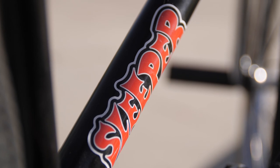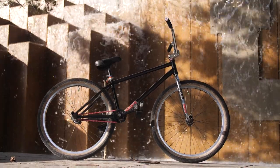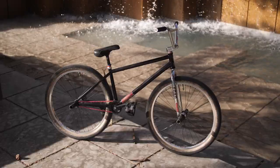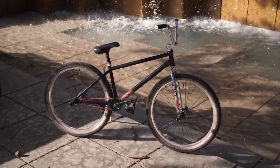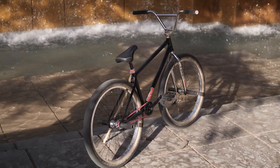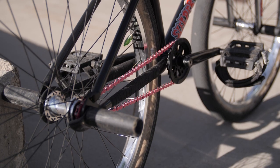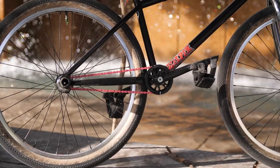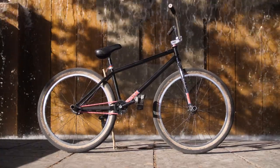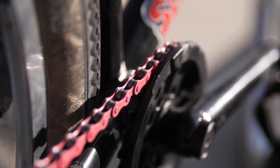I've got a 2021 sleeper frame from Rough Bike Co. This is brand new to me. I'm really happy with the way it's feeling right now — I've only been on it for like a week or so. It's very responsive and snappy. The rear end is shorter than the prototype that I was riding. My drivetrain: I've got a 19 millimeter mid bottom bracket, 170 millimeter crank arm, 48 spline from Profile on a titanium spindle with a Madera 25 tooth sprocket and a bash guard.